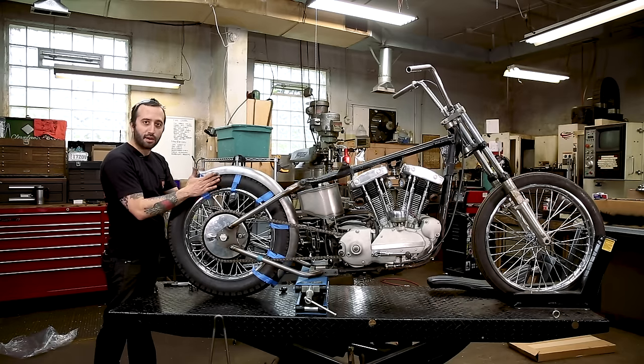The thing where it's gonna help you is when you slightly tack it, you can actually fusion tack one of the bungs where it's touching and then it won't pull as much. But if you have to actually try to tack it where the gap is, it's gonna pull a lot. And anytime you have large gaps, when you fill those gaps, that's where you're gonna get the most distortion. So if you can get these to grind out and actually fit a lot nicer than just using the bung straight out of the box, that would be much better when you go to weld it up.